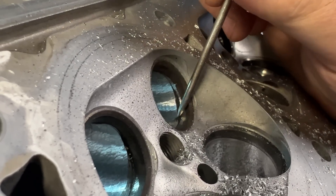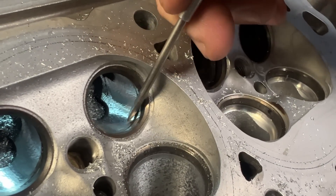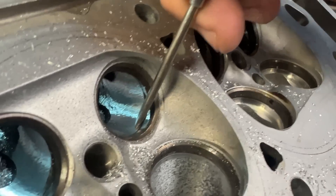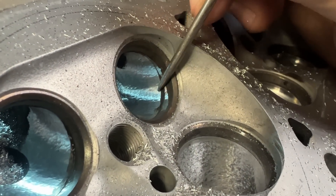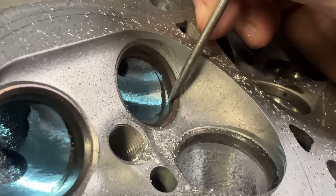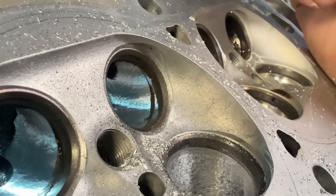I'm going to show you something that is unfortunate. The way that the angle of the port comes in — it's almost impossible to not tag the valve seat when you're doing this. I'm not so concerned about it because we are going to valve job it and I'm not hitting the seat. It's one angle, so I'm not going to really care because I'm not wiping angles out.